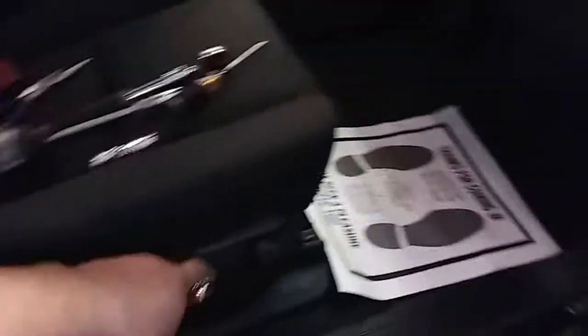Let's get started. We're going to grab the 10mm and loosen up the battery terminal. First things first — the seats are electric, so let's move the seat backwards all the way. Now let's go ahead and remove the negative terminal.